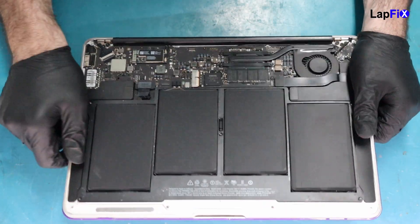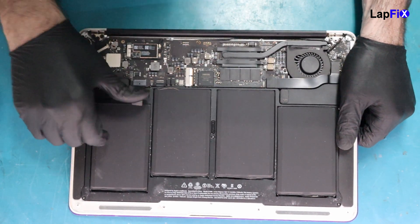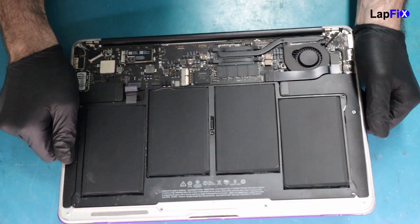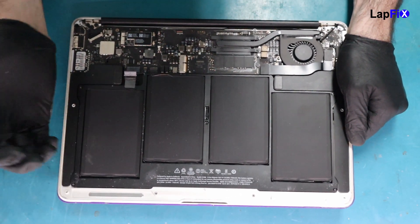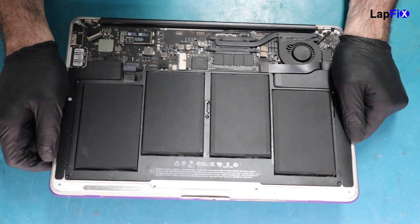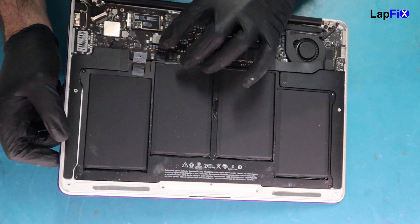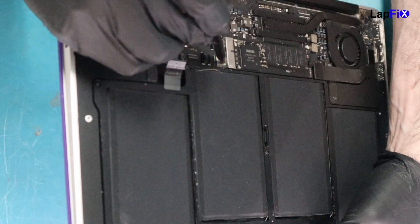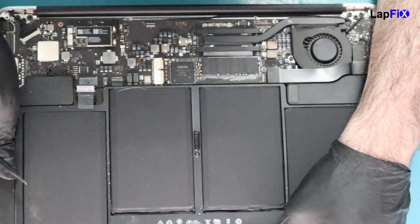This one's in here for a liquid spill. Obviously since it's a liquid spill let's unplug that battery real quick. What we want to do is just a quick scan on the board to see if there's any obvious damage. I can see a little bit — it's a little harder to show on camera — a little bit of corrosion right here. You can see the little white: that is corrosion on the SSD.